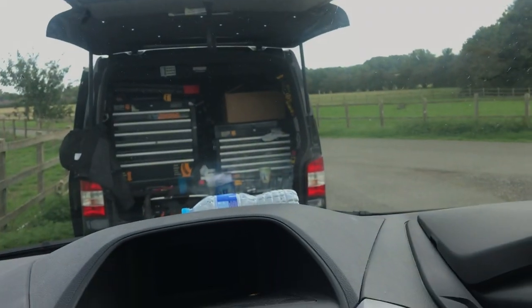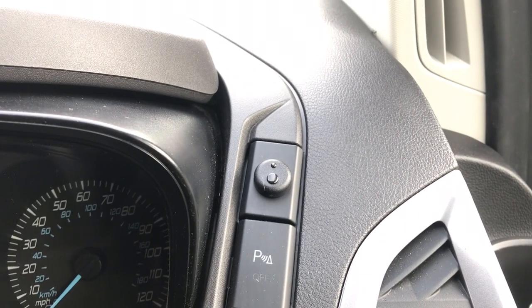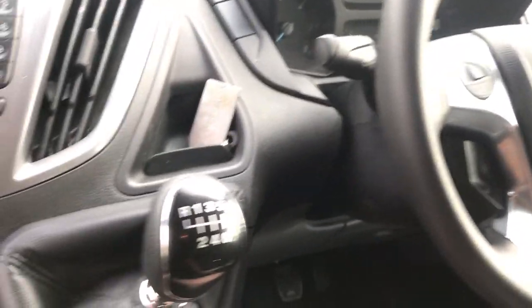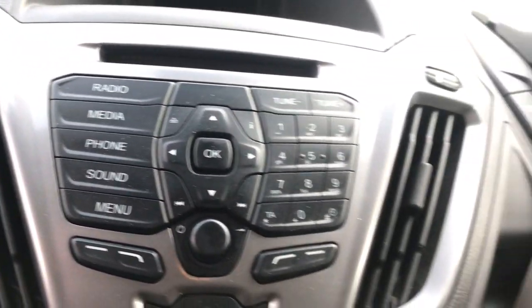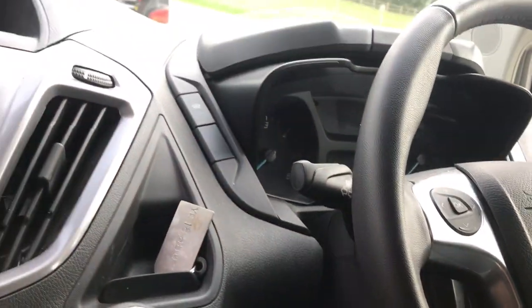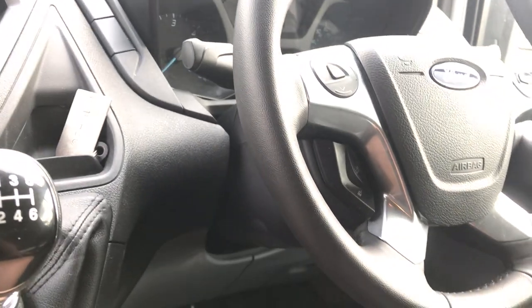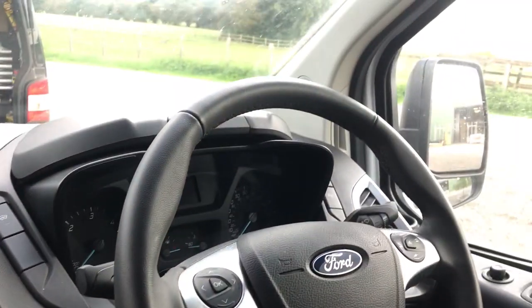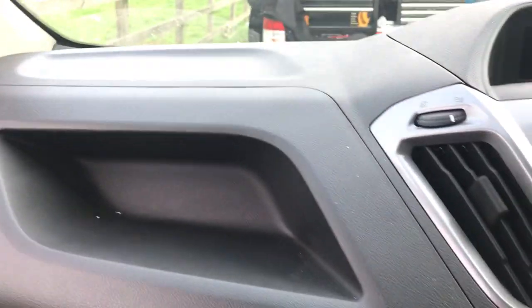The cab lights up quite bright — as I say, the Cobra system's LED isn't that bright. The system has ultrasonics which protect the cab, a single cut immobiliser, canbus integration so it reads all doors, boot and bonnet, and auto rearming if needed.